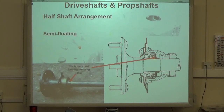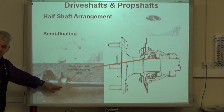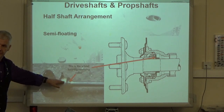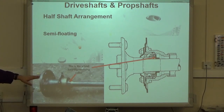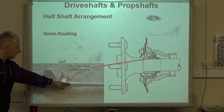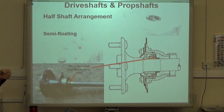And I think we spoke, someone actually brought this up last week about freezing it. Yeah, okay. So I actually found this picture and it shows the bearing arrangements, and it shows the collar that holds the bearing in place. So this collar here, press the bearing on first, and it's not pushed, when I say pressed on, they're not on there tight. It's this bit that's on there tight. This is the bit that holds the bearing in place. And by heating that up, putting it in place and letting it cool down, it actually shrinks onto the half shaft and holds the bearing in place.